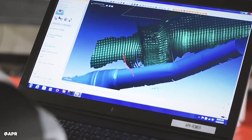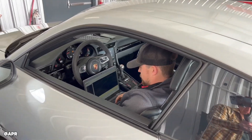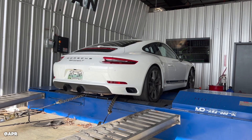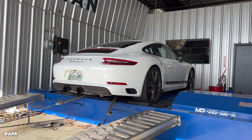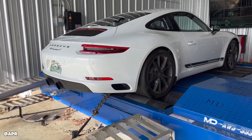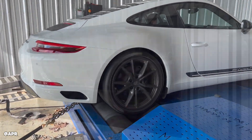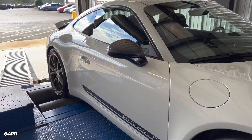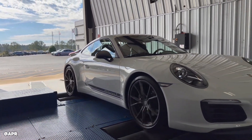We look at the discharge pressure and temperature outside of the turbocharger to make sure it's not going to melt a plastic tube. With all that data, the engineering team puts the car on the dyno and starts working through the calibration, increasing power slowly. On a brand new engine, this process can take up to six months. They verify they're getting the power they want, check they're not over-spinning the turbo or running too hot. If it's getting too hot, we lower the air-fuel ratio, and if needed, we implement ECU code changes — closing the throttle or reducing boost — to make sure the car makes a ton of power but doesn't eat itself.